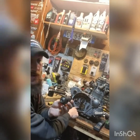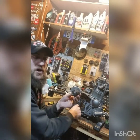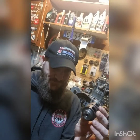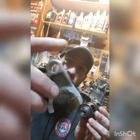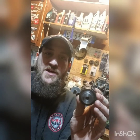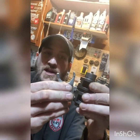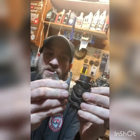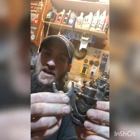This sits on the inside of your case, and on the outside you have the outer drum which is attached to this piece here — your shifter pawl. On the inside of your shifter pawl is the inner rotating drum that attaches to the end of this externally. Your shifter forks have a little nub on the end; this nub rides on those grooves. As you shift gears and rotate it, it moves this piece around to change how it impacts the gears and slides different gears to engage each other — essentially shifting gears.